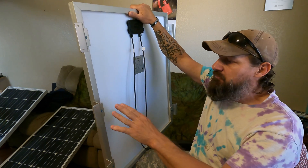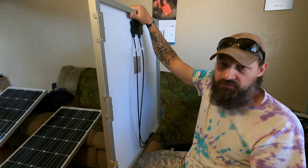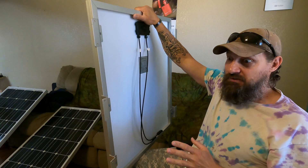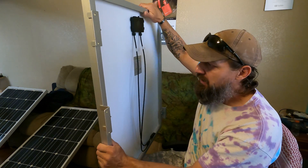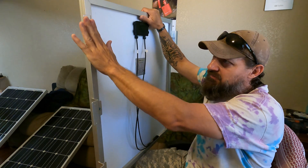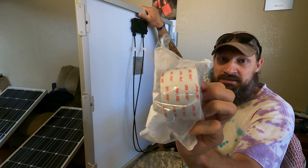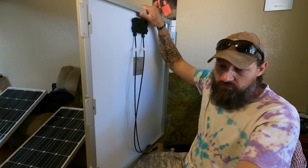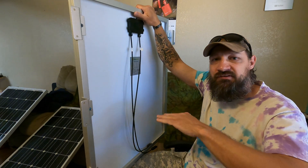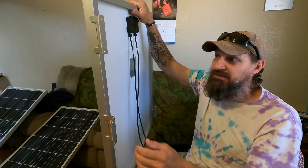I'm not going to be screwing these down onto my roof — I don't want any kind of holes in the roof. So I'm going to be taping these panels down using VHB tape. Taping solar panels down on the roof of your rig is actually a lot more common than a lot of people think. On these surfaces that are going to mate with the roof of my Chinook, I'm going to put double-sided 3M VHB tape — very sticky stuff. I'll put tape on these brackets, make sure that surface is completely clean, pull the paper off, and set this down. Once you set these down with that VHB tape, they are there — they're not going nowhere.